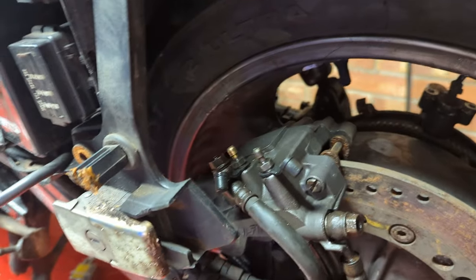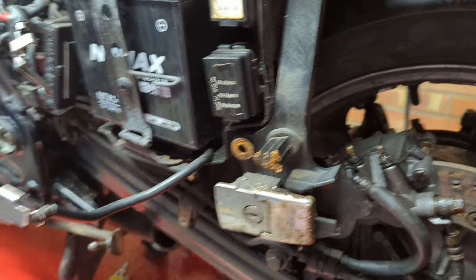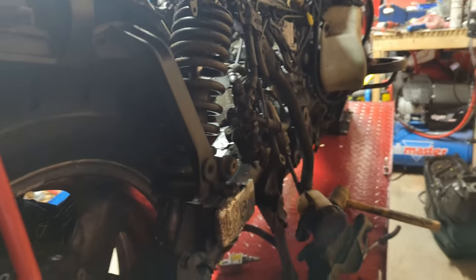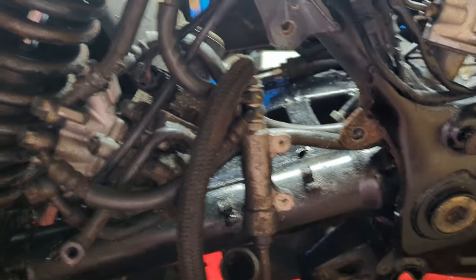Realised I was wasting my life, so I bought that and chucked it on. As you can see, it's still dribbling brake fluid out, but when I press the pedal on the other side, no brake fluid is being moved. I did even take the unions off the top and pump it, and it wasn't working — so that's coming off, and what we're going to do now is take a look at this and see if it's rebuildable or if it's too far gone.